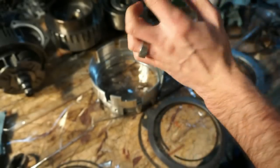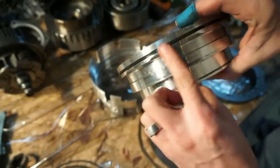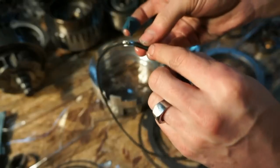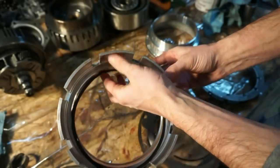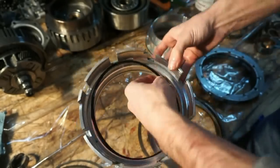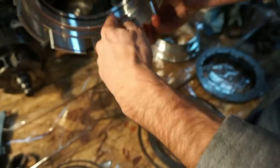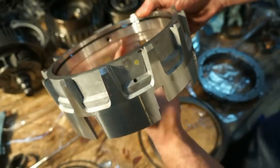All right. So there we have that lip seal in, facing down. And we have this other one, but the lip is actually facing to the inside. Go and do the same thing, push this lip seal in here. That lip seal's in all the way around. This lip is facing down this way. This lip is facing down this way.